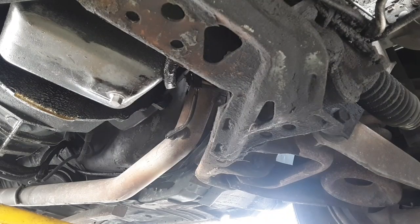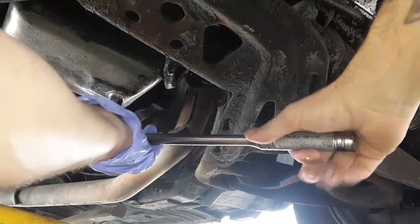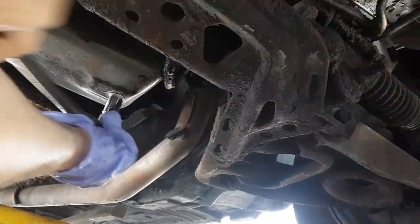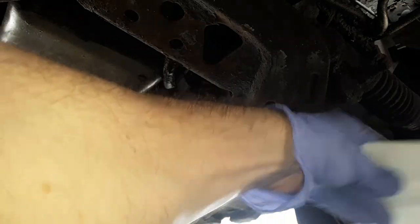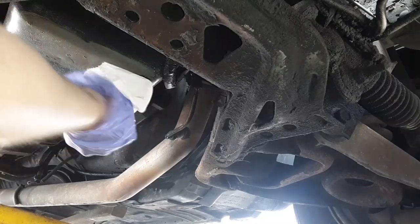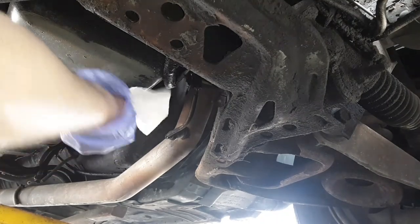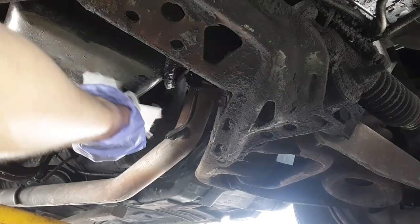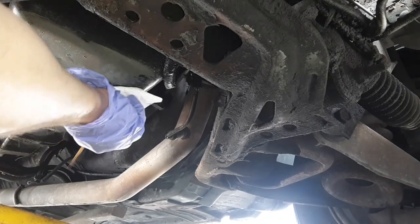So guys, you probably have a 7/8 drain plug on your stock Mustang, but I have replaced mine with magnetic drain plugs by Gold Plug. No, I'm not sponsored by them, but if they would ever want to do some kind of affiliate link, I would probably be happy to do that. These are super strong neodymium magnets, and so these are really good in transmissions, differentials, and transfer cases, because they're going to pull that iron out.